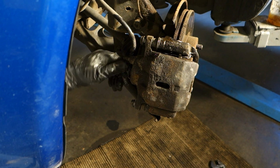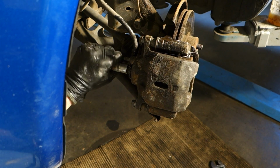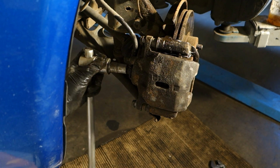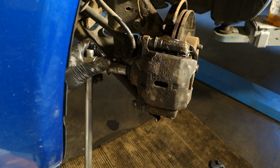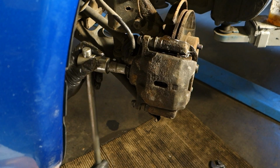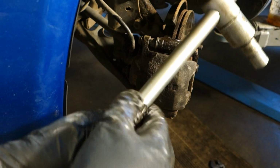And when this bolt is well fastened, I take this. Now I fasten that bolt. Then I need to use a little bit more force. This bolt becomes fast. That way. And this bolt should be tightened with a force of something like 30 Newton meters. We can use a little bit longer lever, but not too much force so that we don't destroy this bolt. Okay, now it's good. I use that kind of longer lever, but not full force.